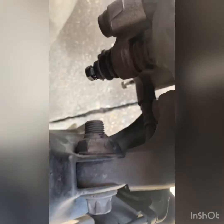Slide it back in, find where the thing locks up. You might have to shiver it around a little bit until you feel like the thread is going in. Then you get that one in, and then don't crank down the top one until you can get the bottom one in hand tight. And you'll feel it when it's starting to grab. It's a little more resistance. Once you get a few turns in it, then you can use your ratchet and crank them down.